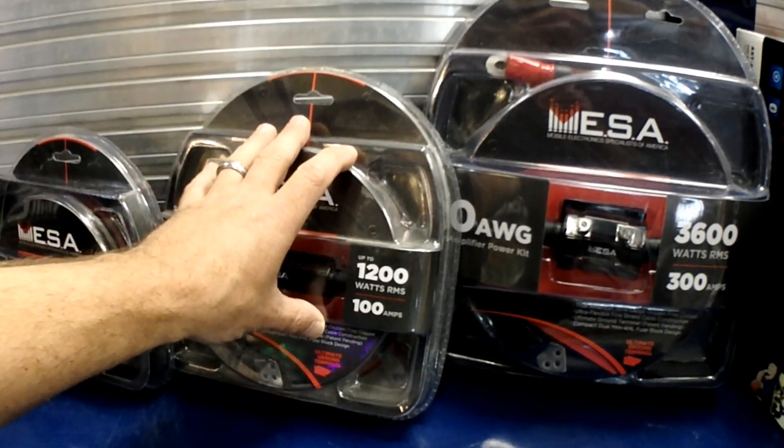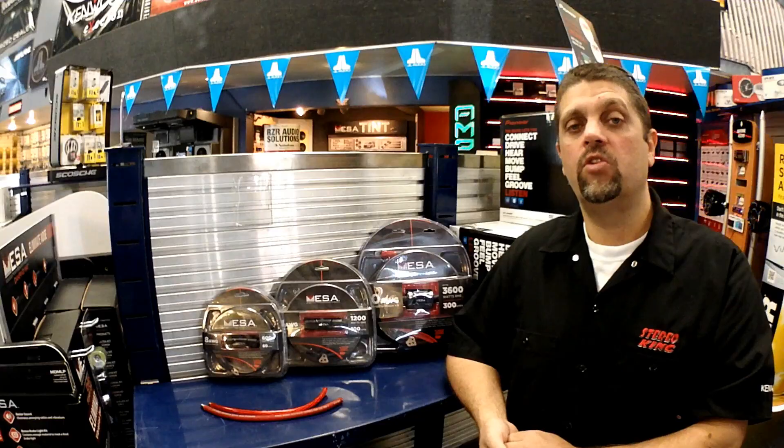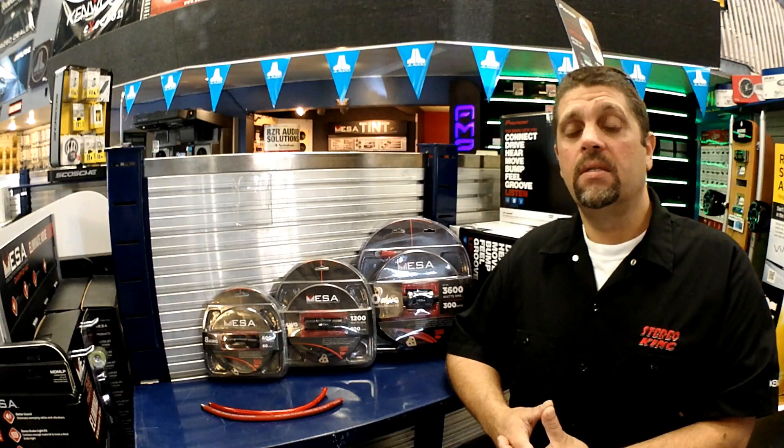Get the right size power wire for your amplifier. Before you make your next purchase, make sure you're picking up the right power wire — make sure it is an OFC product and it is rated in AWG and not just 'gauge.' It makes all the difference in the world. If you're in our neck of the woods, we only carry OFC products. We do not carry anything that's a gauge product or a CCA product — no copper clad aluminum for us. If you're watching this on YouTube, please subscribe and as always, have a great day!